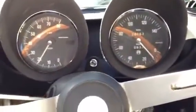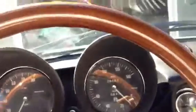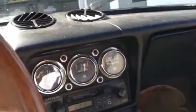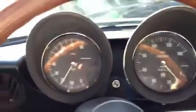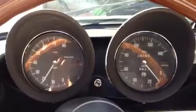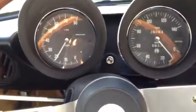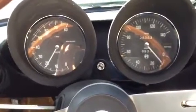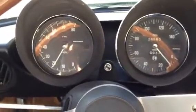Before last night when I adjusted it, the car was running great. But I noticed when you blip the throttle, it just responded instantly — went up, gave it some good gas, it sounded great. But I know when it comes to the Spica unit, that's not what you want to see. So now that I got it adjusted, you can blip the throttle and there's a slight hesitation, which from what I understand is exactly what you want out of the Spica unit.